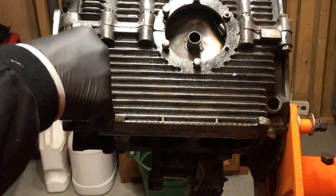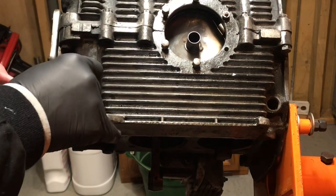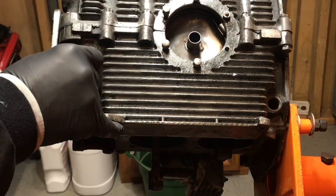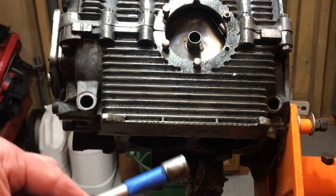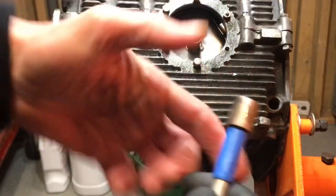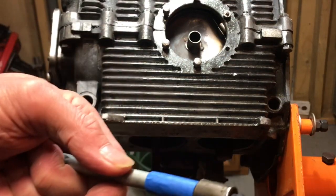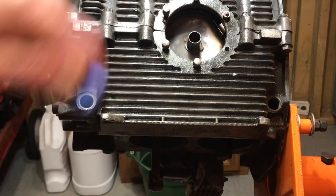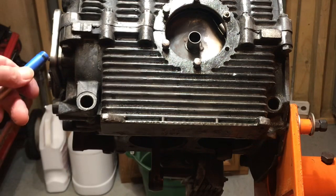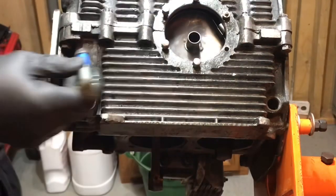Notice that I am not applying any force — it's going in and out easy. Grab yourself a bolt; this one happens to be the one for the starter. Wrap some painter's tape on it, then plug your piston onto it so you can push it in and out and assure that it fits in there fine.